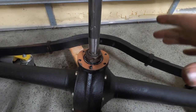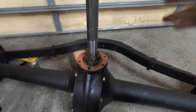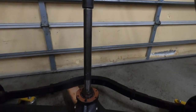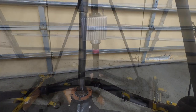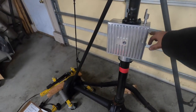Next, get the lower gasket installed — I'll be hitting it with some copper spray since my surface is a little marred. I came through and smoothed some of that out from earlier. Now with my lower gasket in place, a little trick you can use: if your gasket doesn't want to lay flat, you can reinstall those set screws from the protector plate to hold your gasket in place while you set the overdrive unit down. They're pretty shallow so they won't get in the way while you line up the splines.